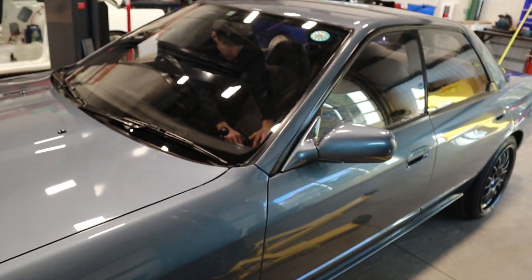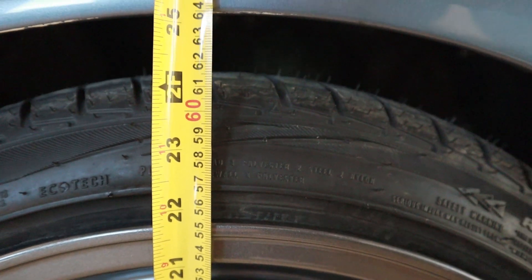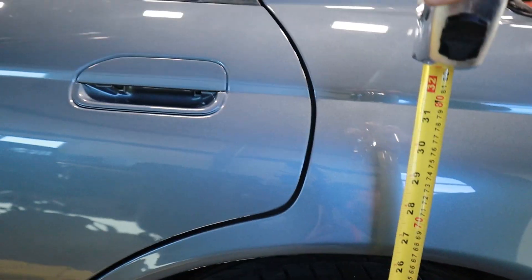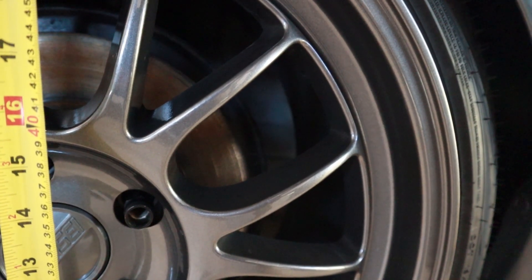Wilson's got her at max lift. The front fender is at 641-642 millimeters. Rear is 659-ish - that's max lift. Let's check out max drop. At max drop: front is 579, rear is 565. Now you know the starting point before we get a little bit more low.